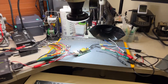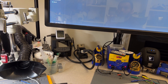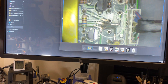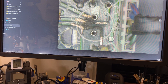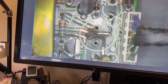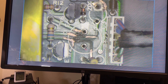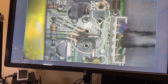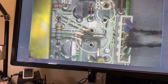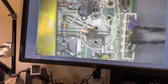When a capacitor leaks it damages the actual board. Let me just show you pictures of how it looked after I removed the capacitors — enhance that a little bit. You can see the destroyed board; it's sometimes impossible to repair completely. It was not the case for Steve, but I did perform a first repair and I thought it was ready.